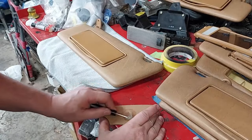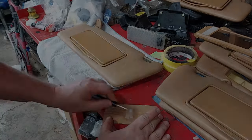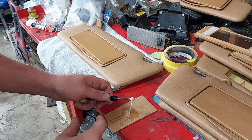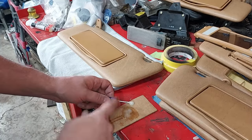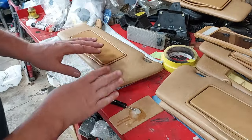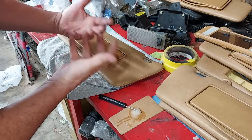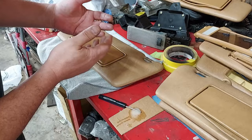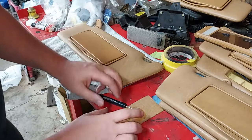You want to have a rag nearby just in case you get it on the vinyl or the MB Tex. Don't use super glue or gorilla glue on these visors — what happens is that stuff emits a gas as it cures and causes white streaking to appear on the vinyl. It reacts very strangely with super glue. This epoxy works great.